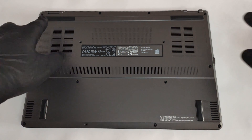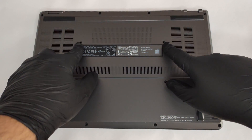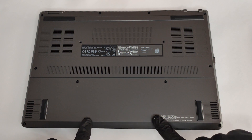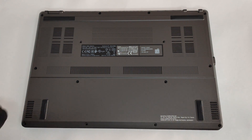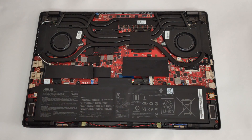Hello, this is Laptop Media. Today we will show you how to open the 2021 version of the Asus ROG Zephyrus G14 GA401. For removing the bottom plate, you have to unscrew 14 Phillips head screws that are holding the plate to the base. Just remove the screws and the bottom plate isn't too hard to be popped up.